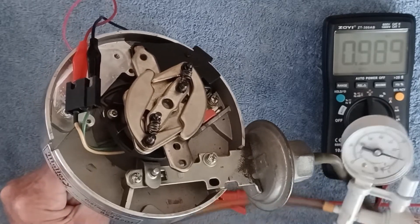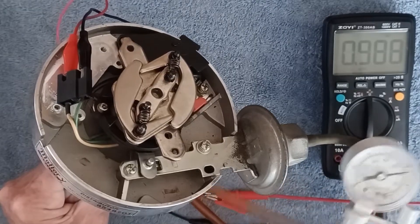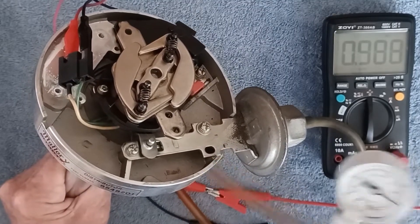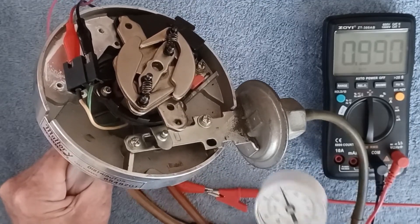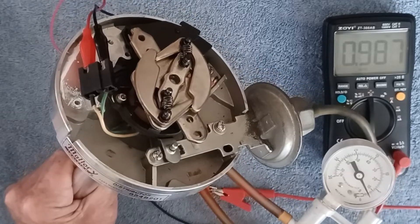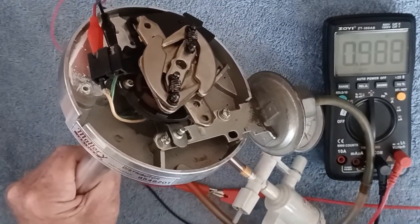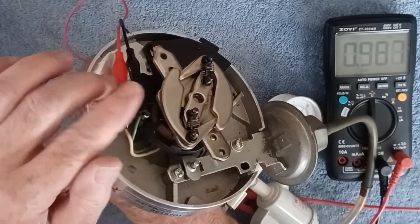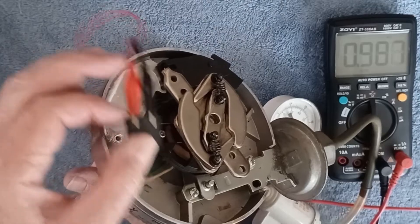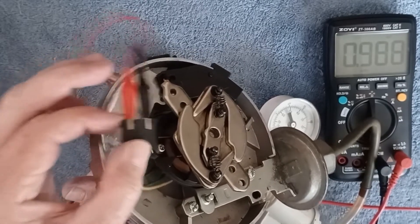If I pump up the vacuum you'll see the pickup coil moves, and as I bleed out the vacuum it moves back — so it's constantly doing that in relation to engine load. Hooking up a MightyVac not only tests the vacuum advance unit and checks it for leaks, but also confirms the pickup coil can move on its bushing and that the wire doesn't show an intermittent break as it flexes. You might see the reading go to OL if it suddenly opened up, but this one looks good.